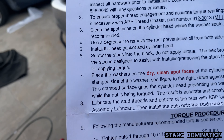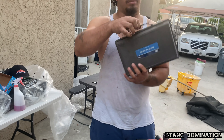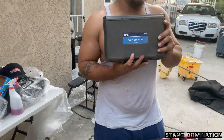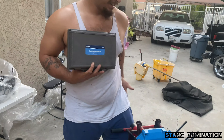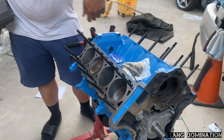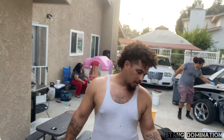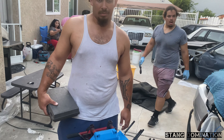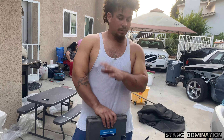Yeah, we're gonna go through this and then get back to you once we figure this thing out. Look at how much it cost — we bought it a while ago. Alright, what we did with the studs: you don't torque them down. You get a little ratchet on them, go all the way to where they bottom out, take off a little bit, and then just snug it up — that's all. Then go to the head gasket and get ready for the heads to install. Gotta get the timing chains and all that ready to go.